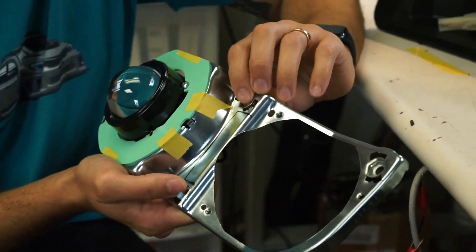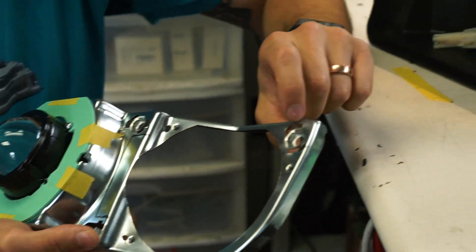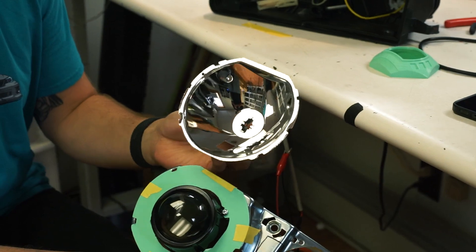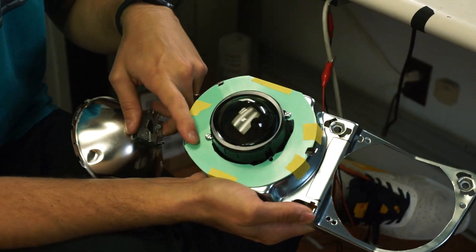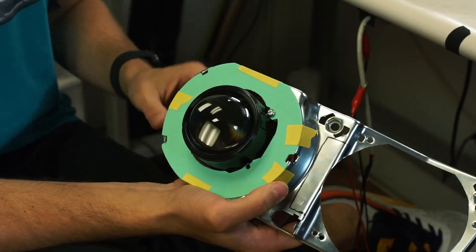These little slits are also angled in certain spots to lock the adjuster in. Given the timeline and these specialty markings, we thought it would be easier just to create brackets to replace the two factory ones. For the high beam, we just took that out, traced it, and added the new brackets. We're going to have Matt at Boosted Creations here in Palmyra cut those for us. They'll press over it so it'll hold in place just like the factory ones did.